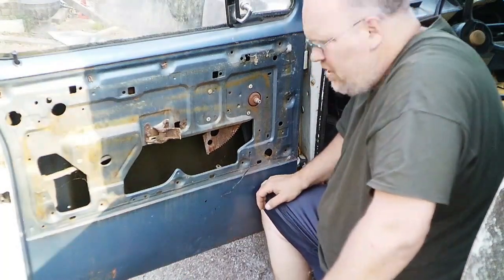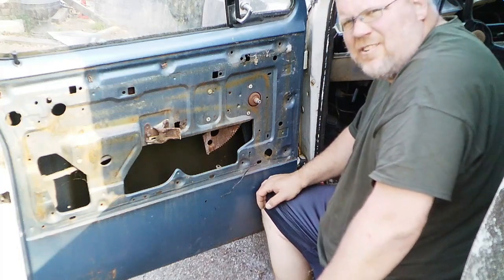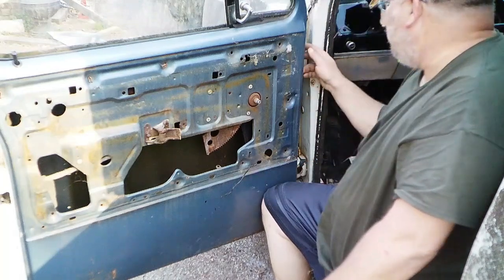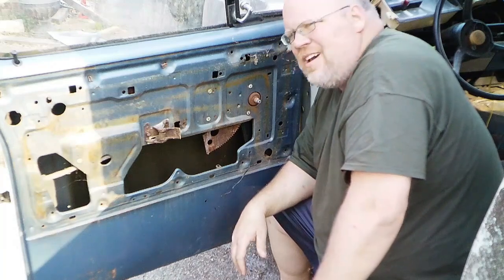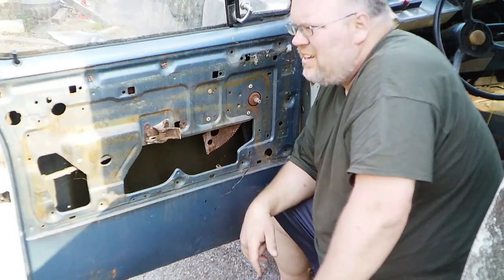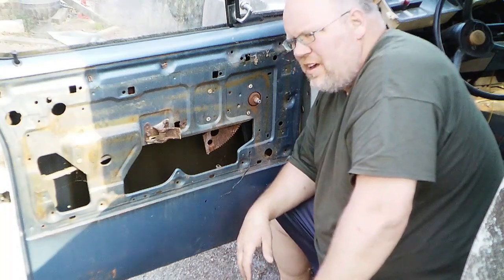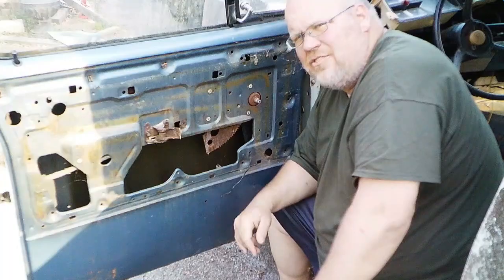Alright. So the wires are run for the lights. I'm going to tie them into the same thing that runs the dome light. That'll work fine. And again, the E6000, that's just going to keep things from moving and getting sucked in, kind of like a sock getting sucked down a shoe. If you never used E6000 glue, and nobody paid me to say this, but that's some pretty good stuff. It's formable, paintable, it dries good. The only downside I think is it's a little on the stringy side, but heck, I fit steering wheels with it. I fit dashes with it. It's quality stuff. I do recommend it.